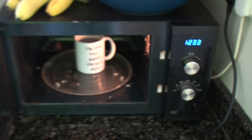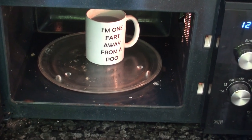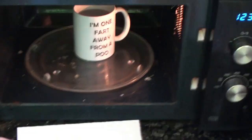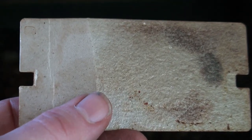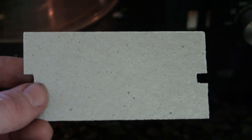It's quite a surprise actually. So if your microwave is just not doing the job, remove that waveguide cover and see whether that's the cause. This replacement mica was about 60p — a new one — and I've tested it and it works fine. There's something about the old piece causing the problem, stopping the power getting out of the waveguide and into the water molecules in your food. So don't condemn your microwave — just get that cover off from the waveguide on the inside first.